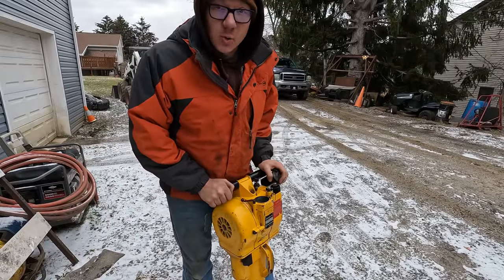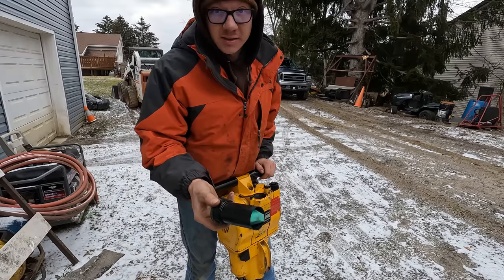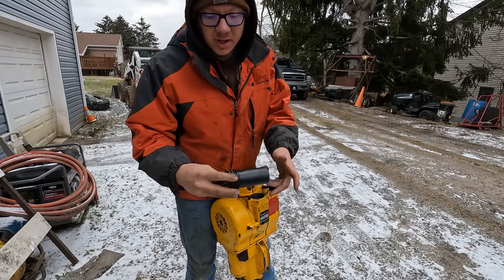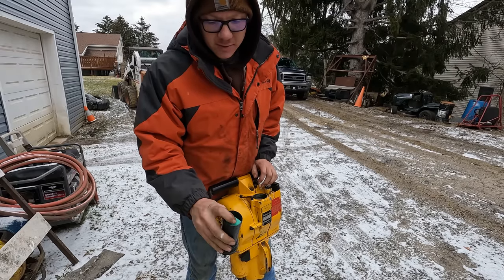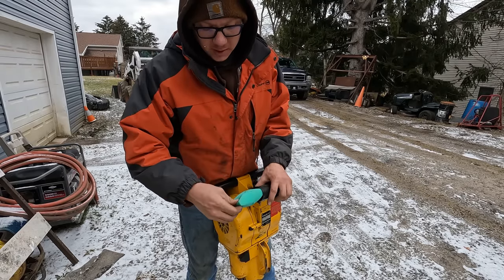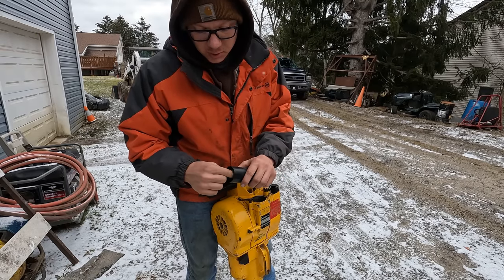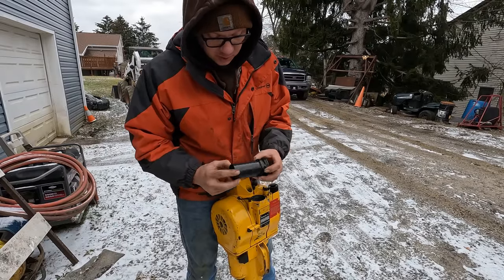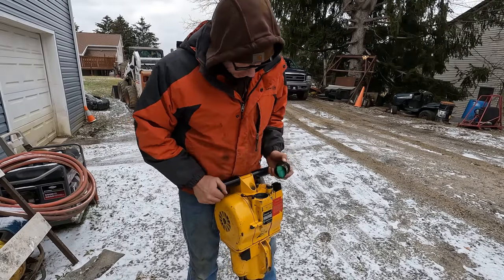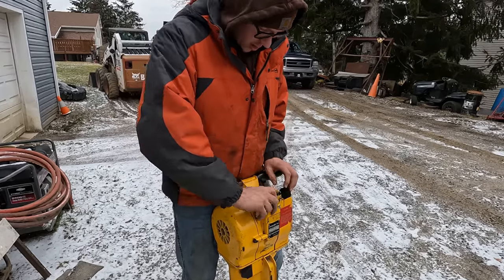All right, it's actually like a week later or so, and I think, like I mentioned earlier, I was able to track down an air filter housing off of Flea Bay, and it finally just showed up yesterday. I did not find the actual foam element that's designed for it, so I just went up to the hardware store and grabbed a couple little teeny air filters that would fit in there. Jammed them in there, they're creating a good seal, so we're not gonna get any dirt down into the intake now. So basically, I hope this works.